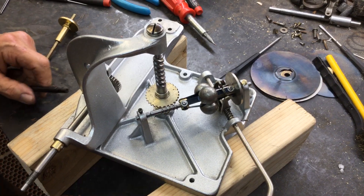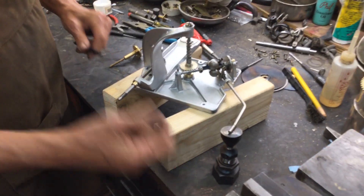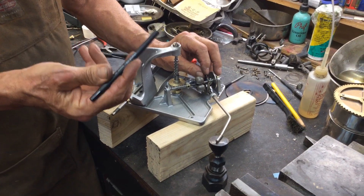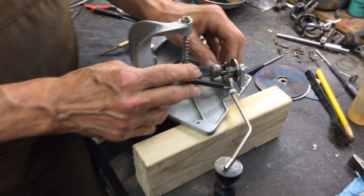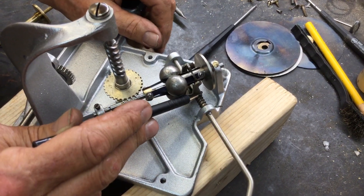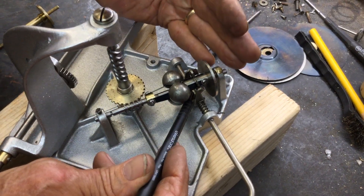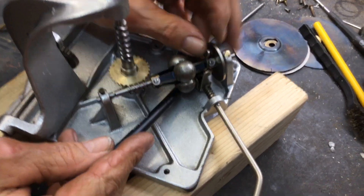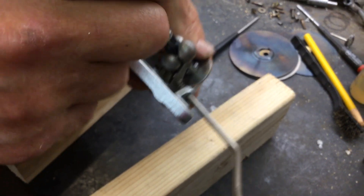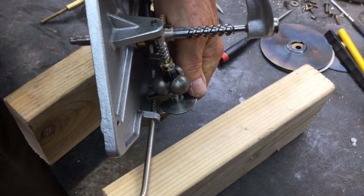What happens is, this is your speed control rod. The speed control is coming up from the top of your motor board here. And this is the snag with Victors on these early fives like this. What you have to do is put the tension spring in, and you have to run this shaft in. This shaft down in here has a slot milled into it, because there's a screw under here — right down in here — and that goes into that slot.